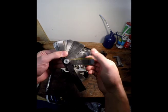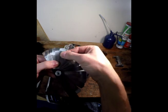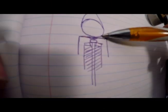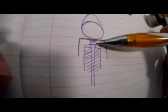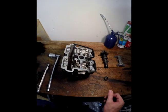The last and most important tool we need is this — our feeler gauge. This has all the different clearances and sizes we need for measuring shim clearance between the top of the bucket and our camshaft. This is the clearance between the bucket and the camshaft, and it's controlled or measured by this shim. The shim is the bit where we make our adjustments — make it smaller or bigger — to bring this clearance within factory specification.